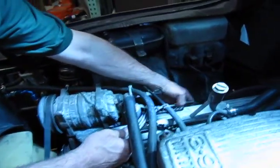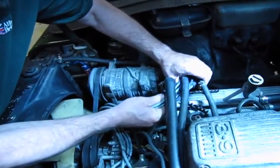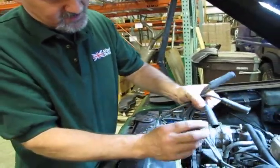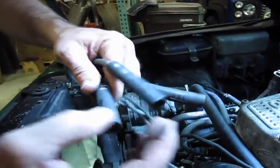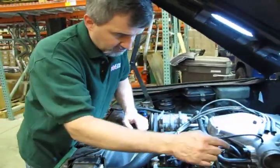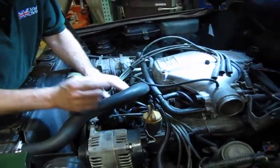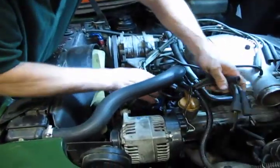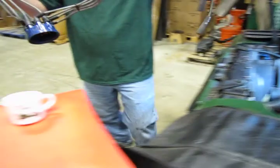Essentially you're going to pull all the wires. What I do is, before you pull the wires, as I pull each one I've been taking a black marker and putting the cylinder number on the bottom of the wire. So I know I've got cylinders 2, 4, 6, and 8 on this side, and then of course 1, 3, 5, and 7 on the driver side, plus the coil wire. I'm simply going to have these marked wires pulled up and set on the bench.